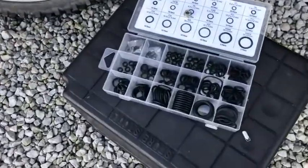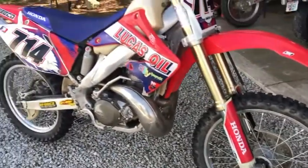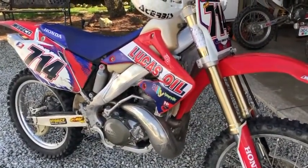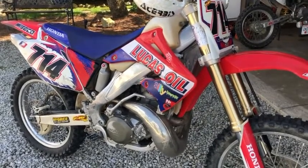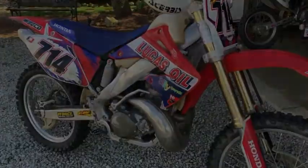So I bought one of these o-ring kits at Harbor Freight, snapped a good-sized o-ring over the top of that seat, put it back together — no more leaks, it's working great. Two things: try the cheap fix with the o-ring, and don't run ethanol gas if you can help it. That'll bugger up your carb. Take care guys.